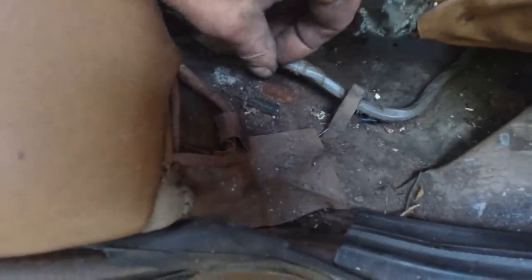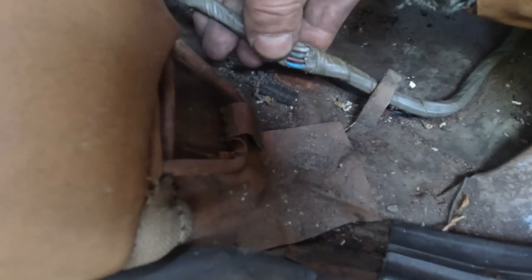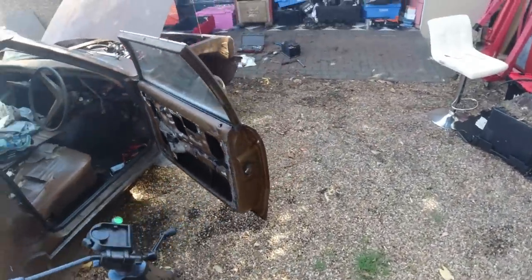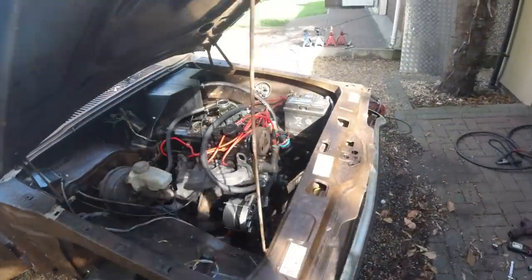Most faults are observation. It's highly likely it's that. I can see the wire there, actually. It's blue and black, and indeed, that is blue and black. Don't know, it doesn't look snapped, but it's probably crushed. Let's have a look. We'll have to split it up. I shouldn't be doing this because I'm trying to get the engine going, but I want that fuel gauge working. It's just one of them OCD things. I'm going to cut into that loom now.